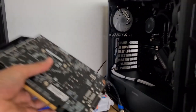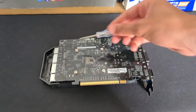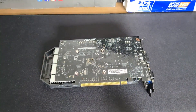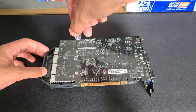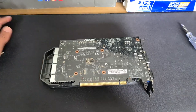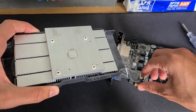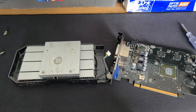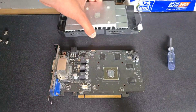But enough of that — it's time to take apart this GPU. All we have to do is take off these four screws and then it'll open up the GPU and we can separate it from the fans. All the screws are out, and now we should be able to just lift it up. I think it's best if we take out this fan — and now it's got dust all over my desk. Now we have the actual hardware separated from the cooling system.